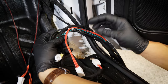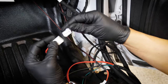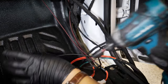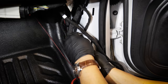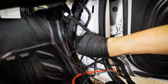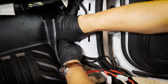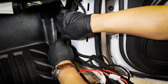I brought both power ends of the harness up to the driver kick area and I'm going to plug these into the main power feed coming from the battery. We're also left with a couple of ground wires, and I'm actually going to attach those to the factory ground point right on the inside of the kick panel — that's a 10mm nut we pull off, slide the two grounds over, and put the nut back on. I'll straighten everything out and zip tie this all along the factory loom, working my way towards the rear passenger seat area.